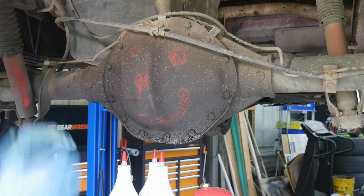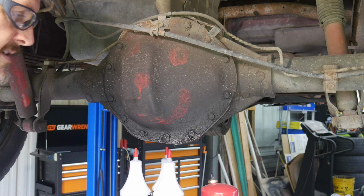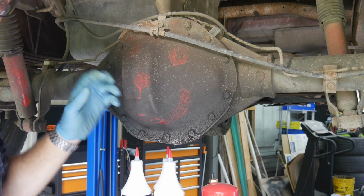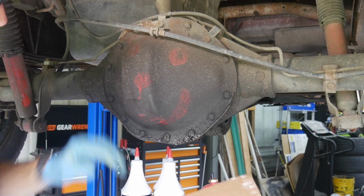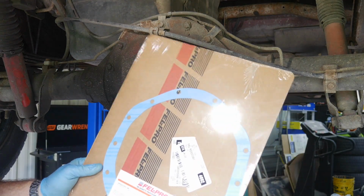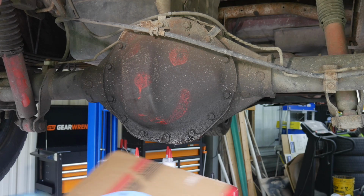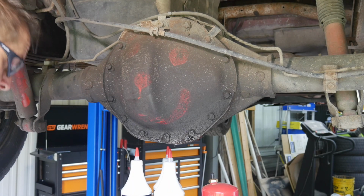So first thing we want to do, I like to clean this up just a little bit. So I'll just take some paper towels. And by the way, this is the Chevy 8 lug, so 3/4 ton. It's actually a 1500 HD, but it's a 3/4 ton axle, so it's a 14 bolt. What you would consider a GM 14 bolt. So I'm using the Felpro RDS 55387. I'll have a link in the description for this, but pretty common gasket for any of your 14 bolt late model rear ends, or a lot of them anyway.